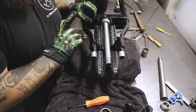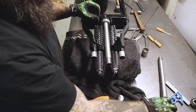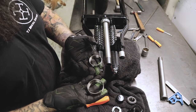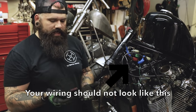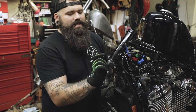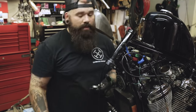So now you have all these extra pieces here: you've got your top cap, your centering nut, and the top bearing. Now let's head over to the neck of the bike and install our bearing races. You're going to install your bearing races in the neck. I like to get a little hand pad — especially if your bike's an older model — and clean out the seat where the race is going to go, the walls. Take away any corrosion, wipe out all the dust, and make sure there's no rust in there. And as I said before, you can stick these in the freezer overnight and they'll shrink up.